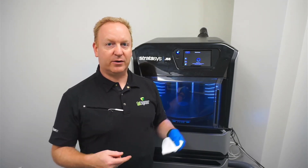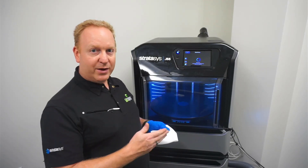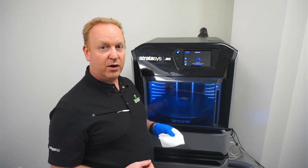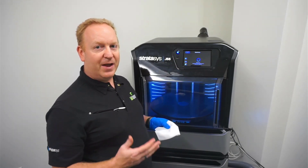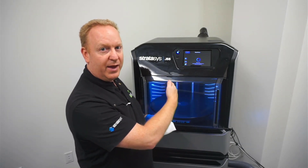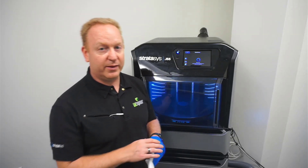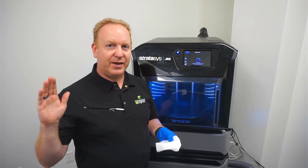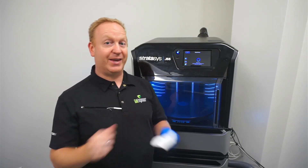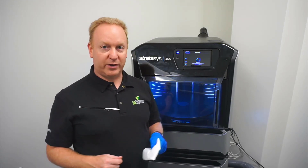This will help them get cleaner and last longer. Once it's ready to go, you'll see a list of items to make sure are cleaned on the screen. I've found I like an order of working right to left: the light, the roller, the heads, and then the cleaning bath, as well as the print tray under and around everything. I like that because it puts everything into a linear path — it's very easy to get everything and not forget anything.